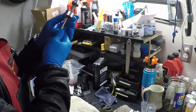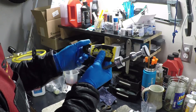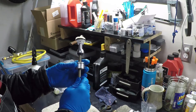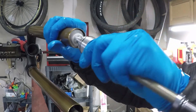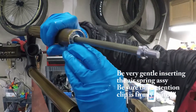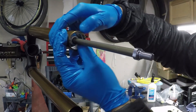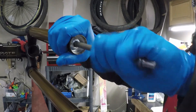Prepping the air shaft assembly — this is the new one, the 140mm travel. Set up a bunch of grease — this is Slick Honey, which Fox defaults to. You can see a little hairdo of Slick Honey sitting on top, then liberally apply it to the seals. Now gently insert the air shaft assembly. Do not rush this — you cannot afford to scratch these stanchions, as it's very expensive to replace since you have to replace the entire uppers and cut your steer tube. Install that clip and confirm it's snug by giving a gentle tug on your air shaft.